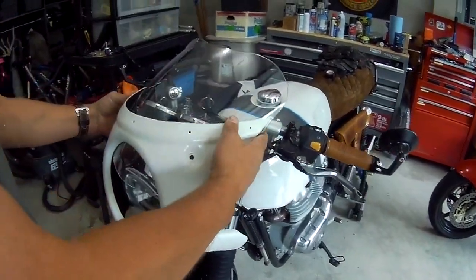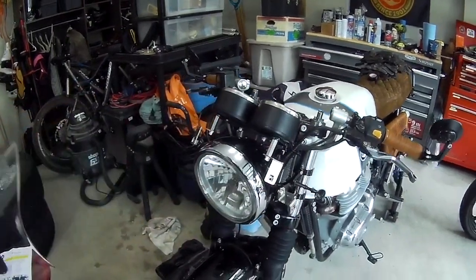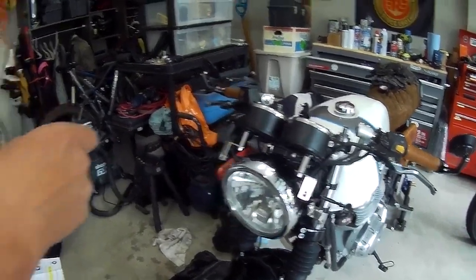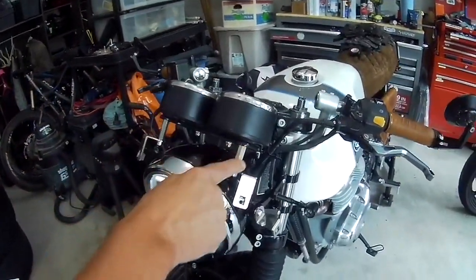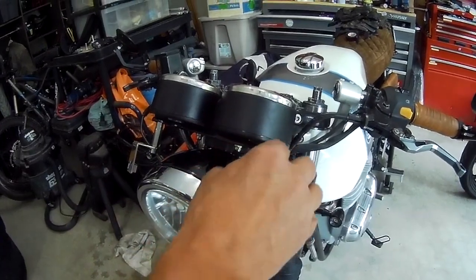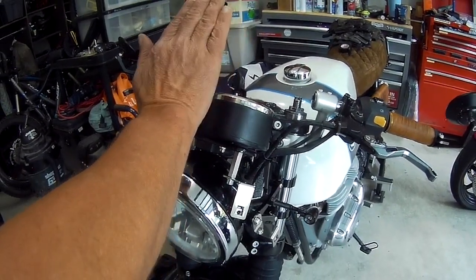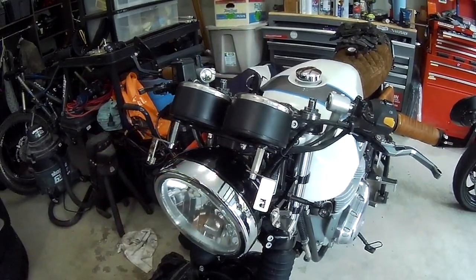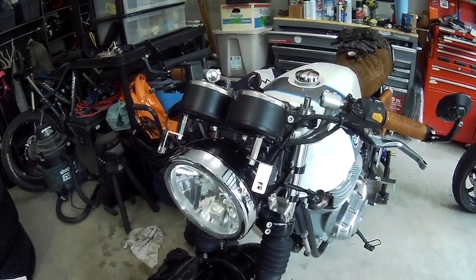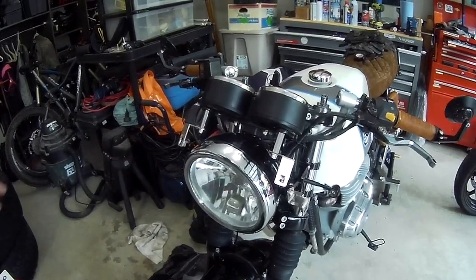With it down, the gauges were partially obscured by the plexiglass. So what I've done — I'll put a link below — I picked up two metric 6 by 10 by 35 adapters. What that does is it drops the fairing down a bit and as a result lifts the windshield up a bit. I put those on and I'll try it. If I don't like it or it doesn't work for whatever reason, then we'll pull it off, but that's what I've got on there right now.